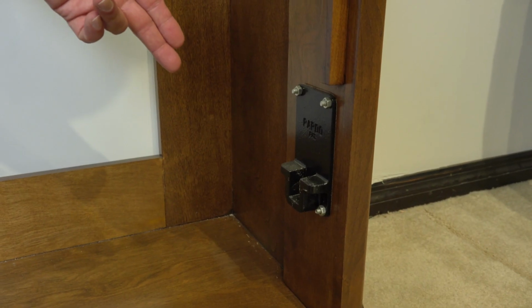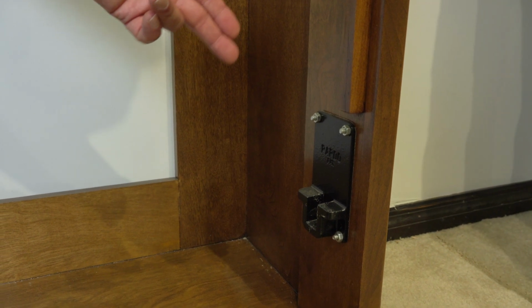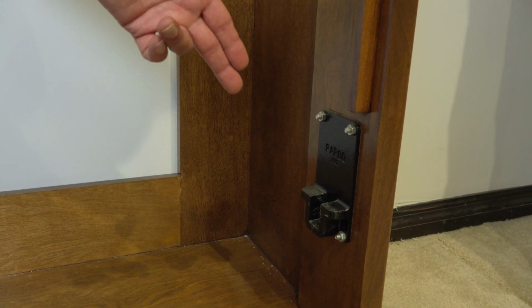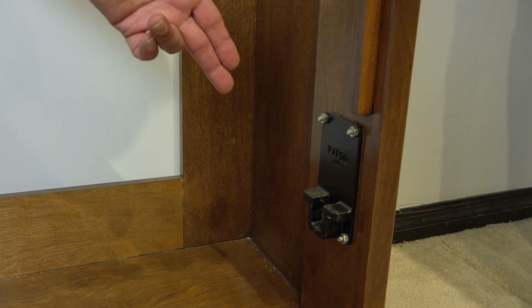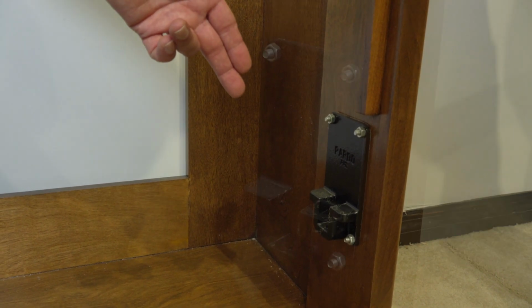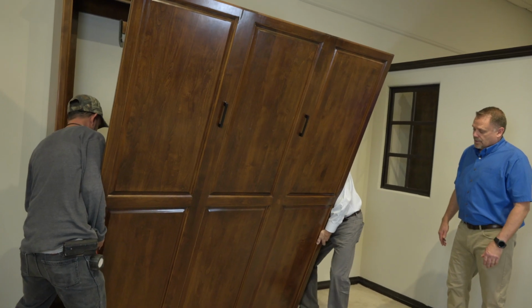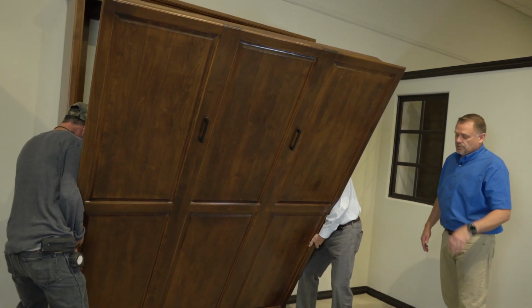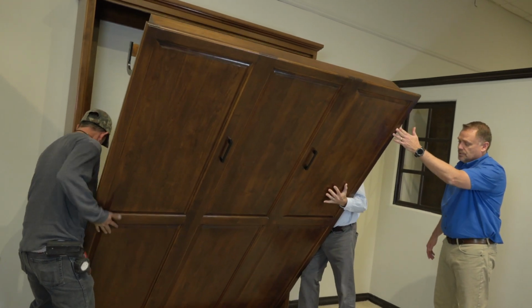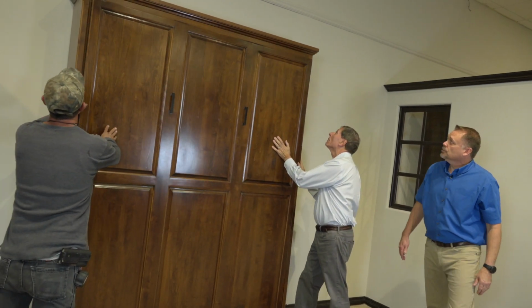This is the saddle mount on the case that the square axle is going to set into. You will want your square axles to be at about a 15-degree angle to slide into the saddle mounts for easy installation. Once they're inside, you can make any adjustments that you need to make everything sit square. As the axle is set into the saddle mounts, gravity will do the rest. It slides. There are no separate attachments as it goes.